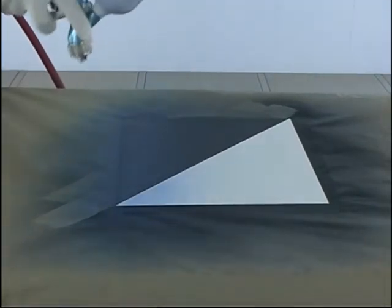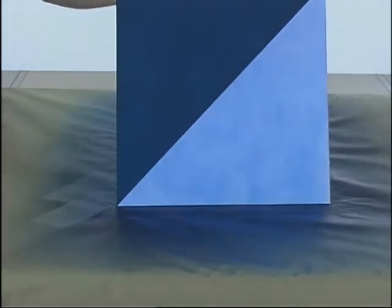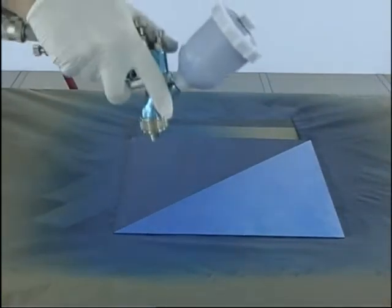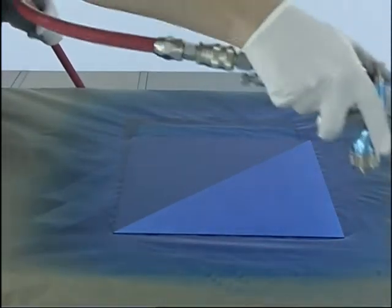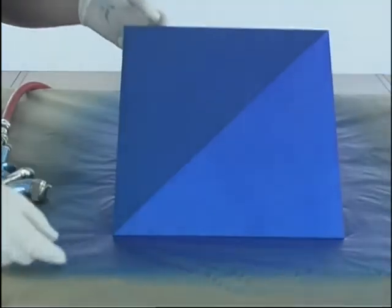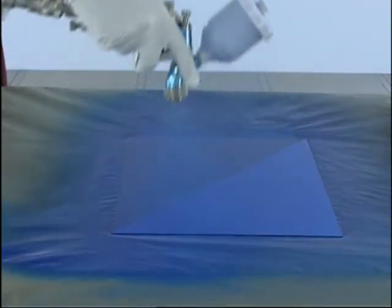Now I've got a 50-50 mix and I'm using Metallic Blue. I tend to shoot most of my metallics and pearls over black — I do this for three reasons: ease of use, less paint, and maximum brightness. You see in my first coat the white part of the panel looks a little bit mottled, a little bit pasty, whereas the black looks absolutely fine. I'm coming in with my second coat — I'm going to reach a sealing coat in three coats, which is complete coverage. It's considerably easier to spray this stuff over Base Coat Sealer Dark. You can see the second coat — both sides are starting to neutralize already, but the black panel always looks better, brighter, and more even.